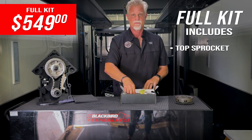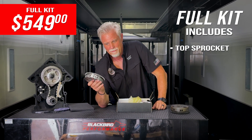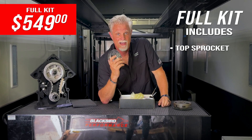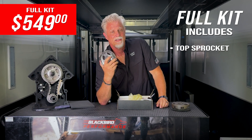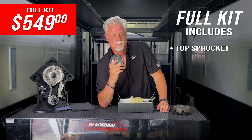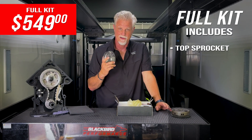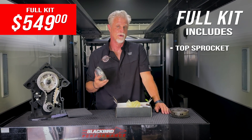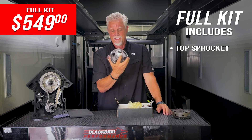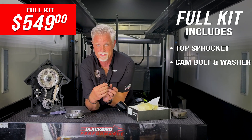When you open up the full kit, you're going to get that top sprocket. That top sprocket is one piece — all one piece of metal made from billet. The teeth are hardened and shaped exactly to work with the factory timing chain. Why do we use the factory timing chain? Double roller chains have some advantages, but for the most part they're not as good as this factory-style chain. This is a very strong chain; it doesn't stretch under higher RPM use or high valve train loads, and it's been proven to work very well.